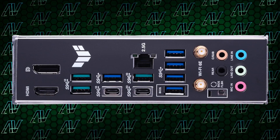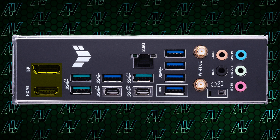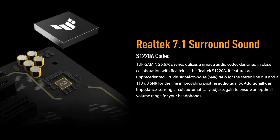You also get two USB Type-C ports at the back — one 10 gigabit and another 20 gigabit — something you just simply don't see a lot of at this price point. Add to that 2.5 gig Ethernet, Wi-Fi 6E, integrated DisplayPort, an HDMI, and not six but rather five audio jacks. Because once again, Asus seem to think it's more important to awkwardly put in a BIOS flashback switch there instead of a sixth audio jack or optical SPDIF. It's still better than Gigabyte motherboards which still only offer you three audio jacks, and it's all powered by the Realtek S1220A codec.